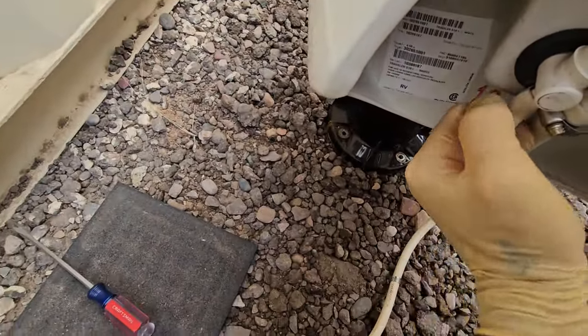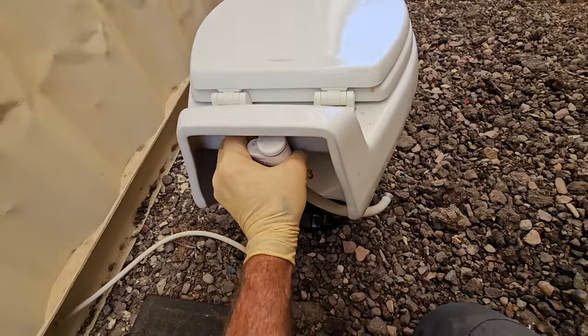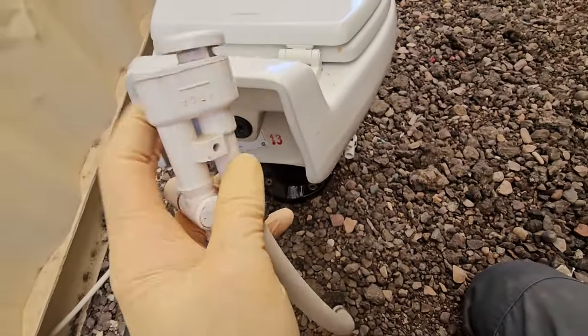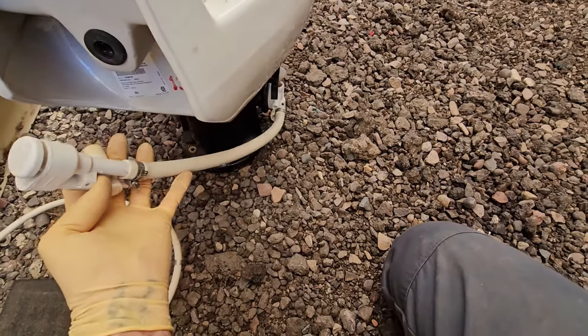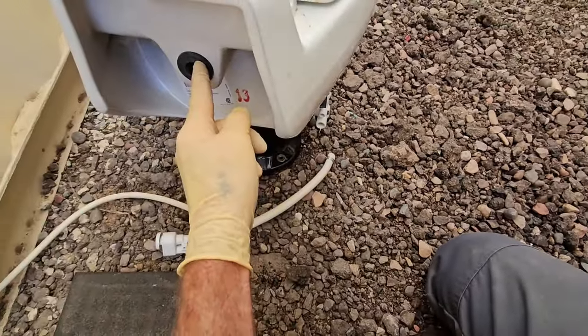Hopefully now we can just pull this off the vacuum breaker. Now, vacuum breaker is another common failure point on a Sealand Traveler. That goes into the china or the porcelain bowl. Just fits in there. It's a vacuum breaker. This is there for hygienic purposes. So as we can imagine, water leaves the water valve there, comes up into the bowl.